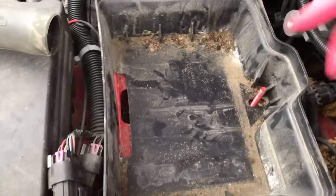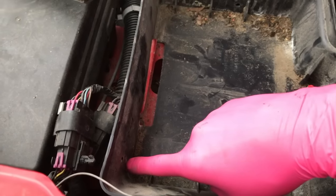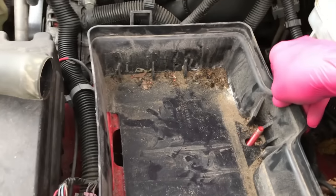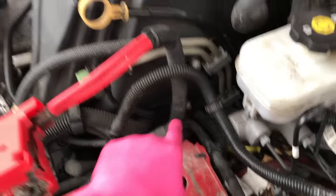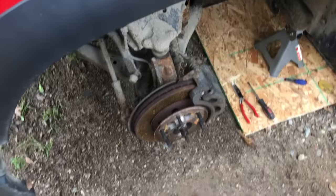Battery is fully removed, and we have two additional connection points. They are plastic — be careful. One there, and one comes through that little hole right there. After removing those, we can basically pull the entire battery tray out. At this point we have better access to a few screws, and we will ultimately be removing this entire throttle body. With that said, we've got to come down below.